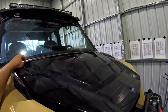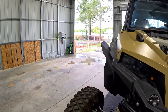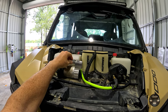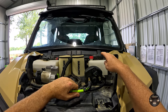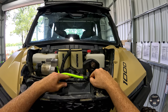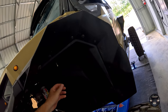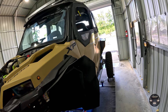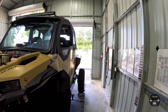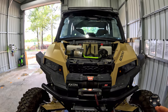Under the hood is a really convenient item — a small compressor originally made for a Jeep kit. It puts air into a control box, which feeds through PEX lines running through the vehicle to valve stems in all four wheel wells. In my drive box I have four pigtails that connect from the wheel-well valve stem down to the valve stem on the wheel. When you hook all four up, they equalize all four tires.